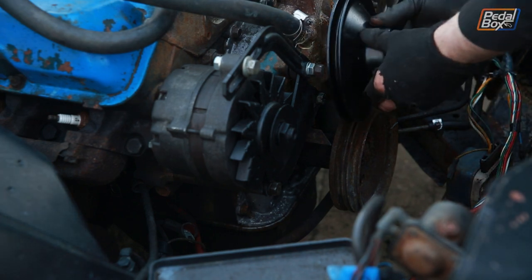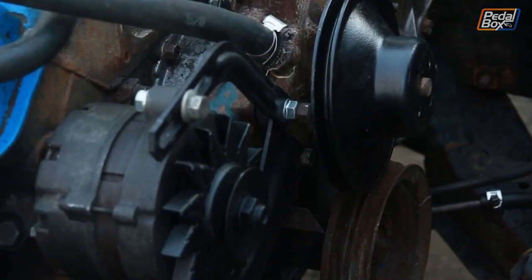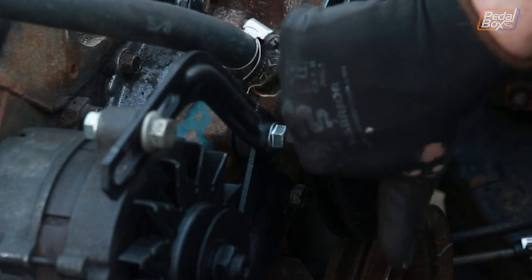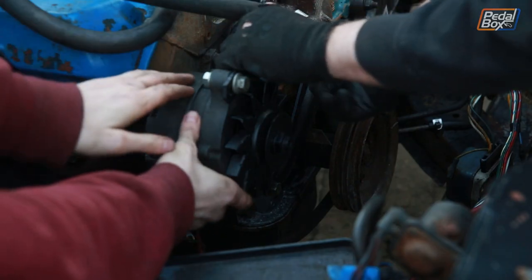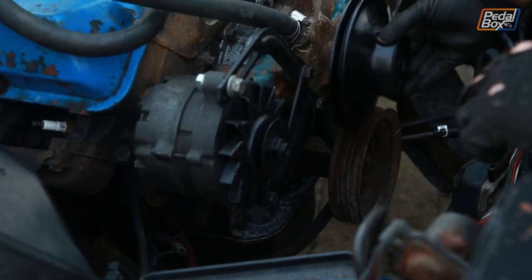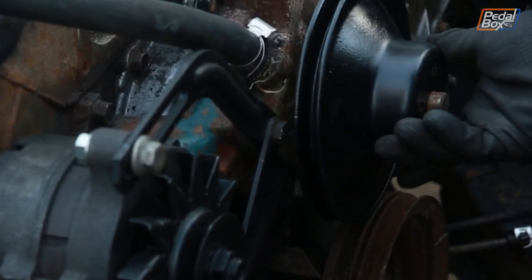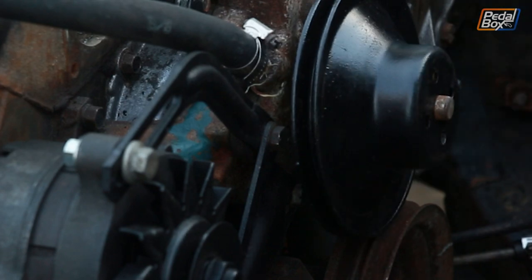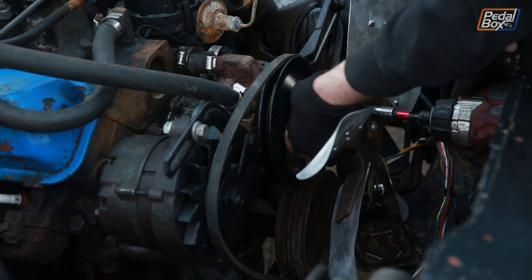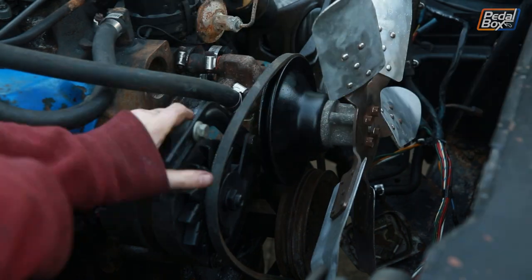Full success - or not. The Franken stud we made with an M8 nut as a washer now sticks too far forward and clashes on the pulley. So we took out the lazy spacer, shortened the stud, and even removed a little bit more of the head - actually a seized nut on the stud, which is why we'd discarded it previously. This gave us all the clearance we needed for the pulley. We could reassemble everything, add the fan back on, and from there it was plain sailing to install the thermostat housing and expansion tank.